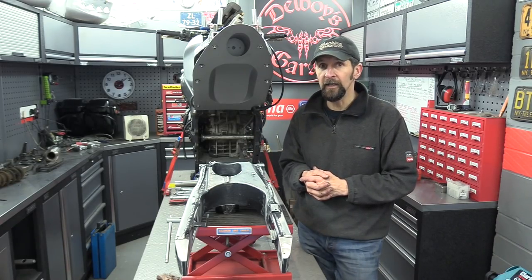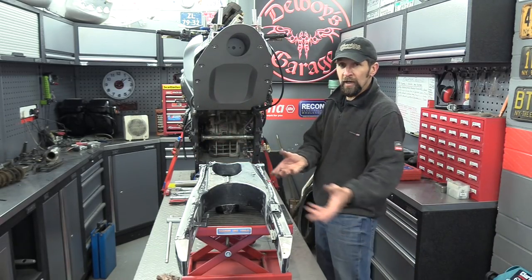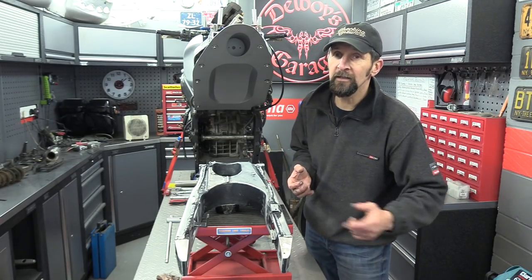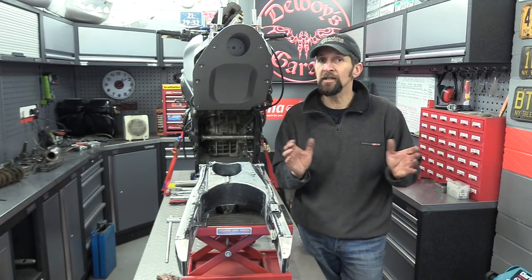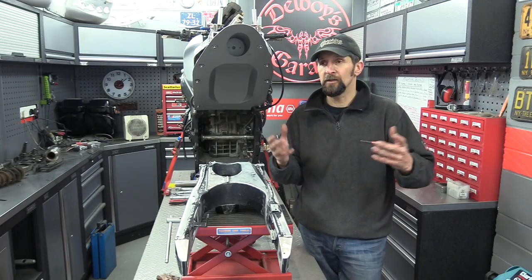take about 2 weeks to dry, and then I can paint all of the back of this, paint the back of the frame, and then put it back in. So that's that done. And then I've got the wheel in because the wheel is now painted. The wheel bearings will be done once the tyres are on, because when the tyres are on, I can stand the wheels on the bench with the tyres touching rather than the rims. It's just a safer way to do it. Makes it a little bit easier, not going to scratch the paint up.